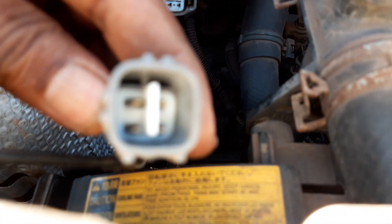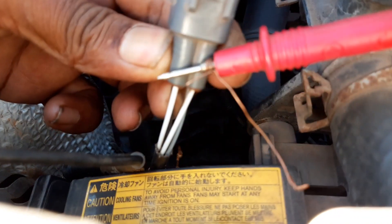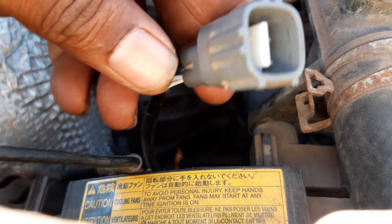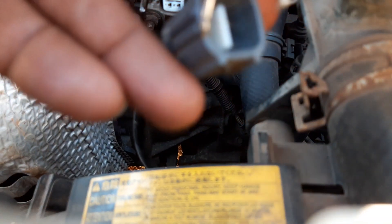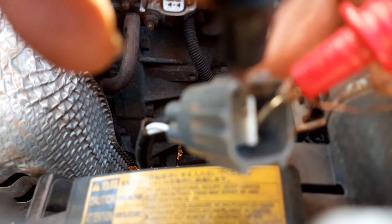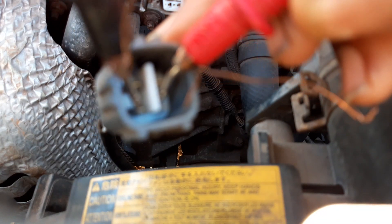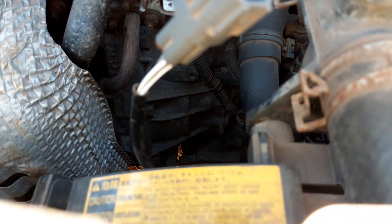Here's the wiring. We're looking at these two white wires — they are the two bottom connections here. I'm going to use the multimeter tester to check those two bottom connections. Once we hear a sound from the meter, it is telling us that the heating circuit is okay.